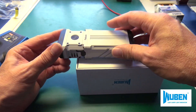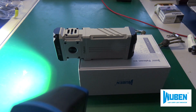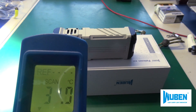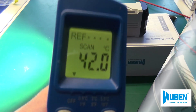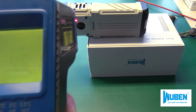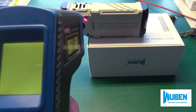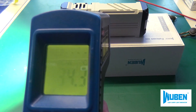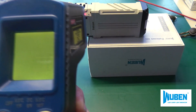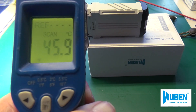Let's test how hot the whole thing gets. I set the lamp up and switch it on. I have a temperature measurement device — an infrared thermometer — to check the readings. The heat is generated at the front, and the internal fan is already running. The lamp heats up and we can see it going up — it levels off at around 45 to 47 degrees. The handle at the rear stays much cooler, around 30 degrees, because there is insulation between the two components. The grip always remains comfortably graspable. The fan keeps the lamp at around 45-47 degrees.